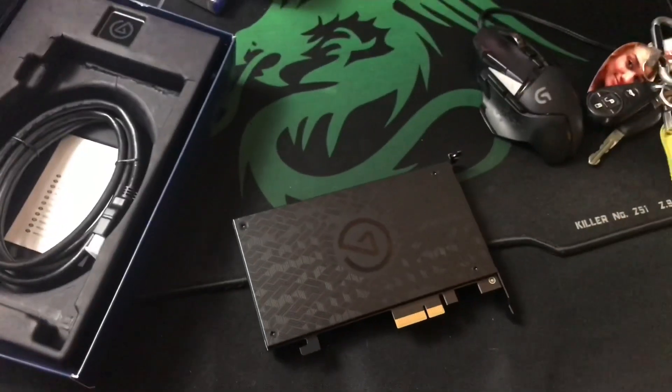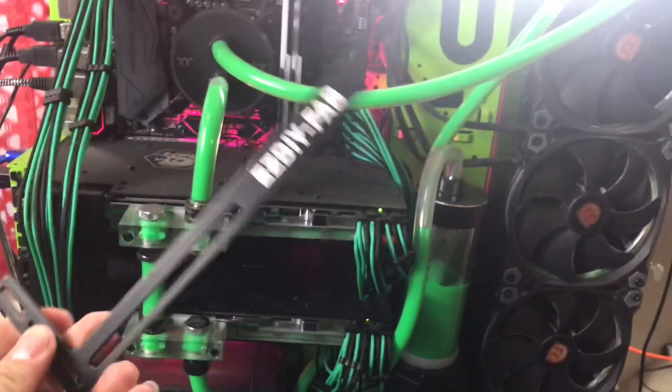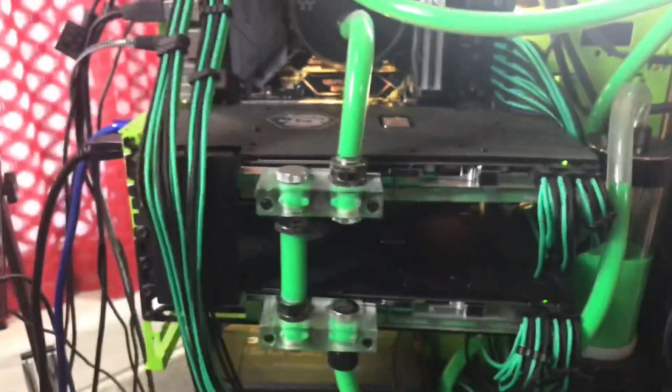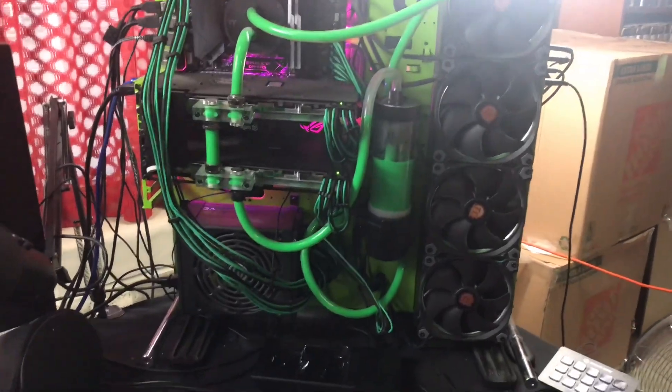All right guys, in this next part I'm gonna show me installing it. I took off the bracket — it made no difference anyway — and there it is, I installed it into the graphics card slot. You can see it right there. Very simple: push it in, it clicks all the way. Now all I have to do is turn it on and test it out, hopefully it works. Like I said, it's very simple — take off one of the brackets so the slot is open, slide it right into your PCIe card slot, and you're good.